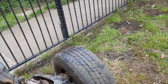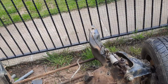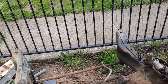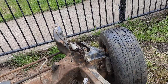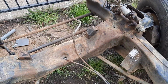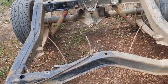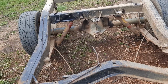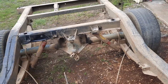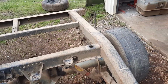So I'm going to remove all of the suspension parts now. Steering, I've got all new bushes, new tie rod ends, drag link, the whole bit. So they're about to come off, and I'm going to pressure wash it, scrub off any surface rust, and I'll prime it with the red oxide and then paint it black. So I think I'll probably do the underside first. Once I strip everything off, I'll flip it over, with some help, obviously.